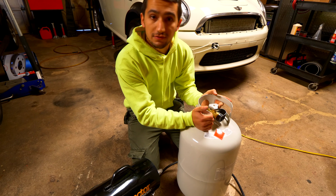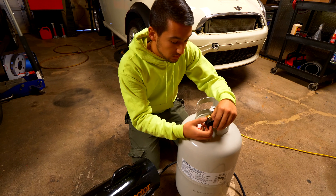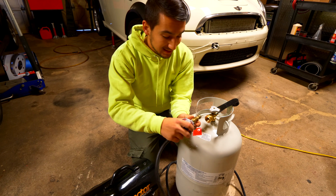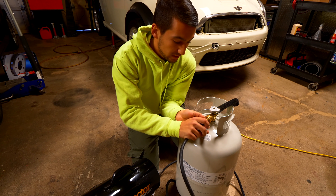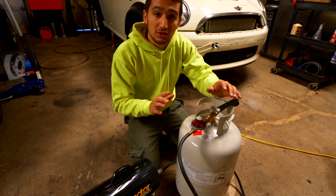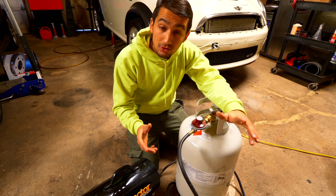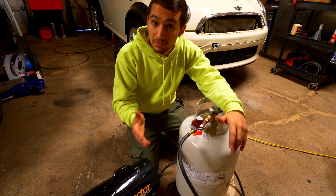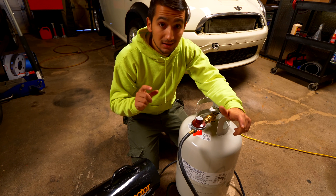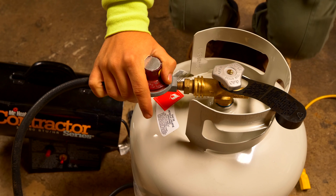To get started, we begin at the propane end. You need a tank filled with propane. Take the little end off and thread this part — which is part of the heater — into the end of the propane tank. You'll need a wrench to tighten this on and get it fully secured. Now when you're working with propane, it's always smart to be careful. Read the labels. Don't be stupid because this could potentially kill you if you don't know what you're doing — leave it to the professionals if unsure. The threads on this, however, are not like a regular bolt. It's not lefty-loosey righty-tighty — it's the other way around. These are left-hand threads, so make sure you're putting it on the right way.